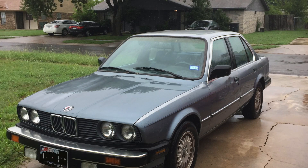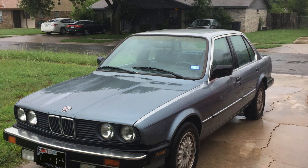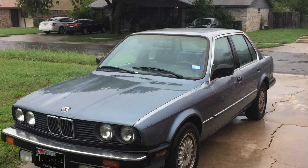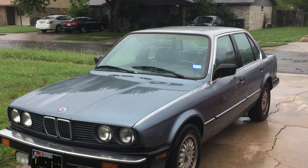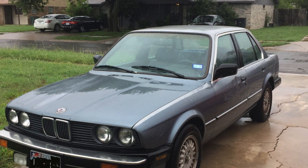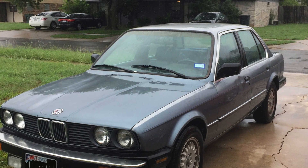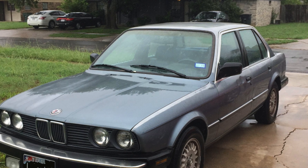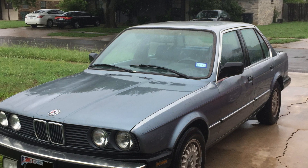After completing this process, I checked the coolant level after a couple days of driving and the level dropped 2 inches below the fill line — that is normal as air continues to bleed out of the system. I filled the coolant level back to the fill line, checked it a few days later, and the coolant level has been holding steady, so the job is done. Don't forget to recycle your coolant and clean up any messes so animals don't drink spilled coolant — and happy wrenching.